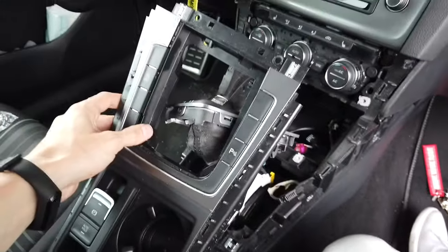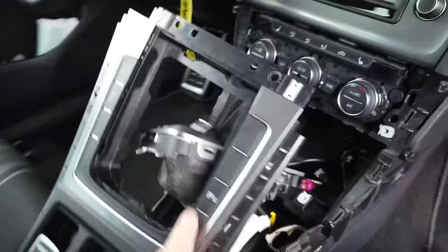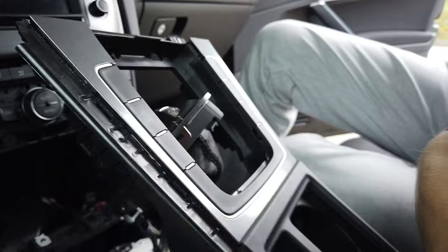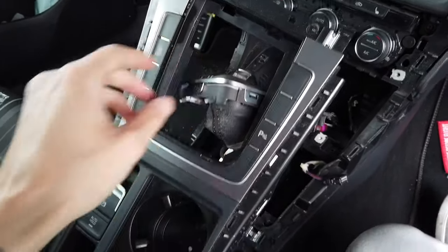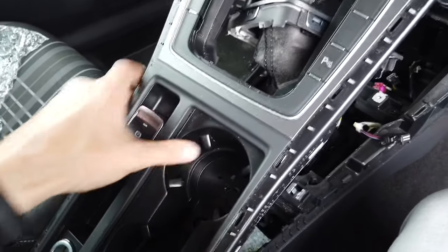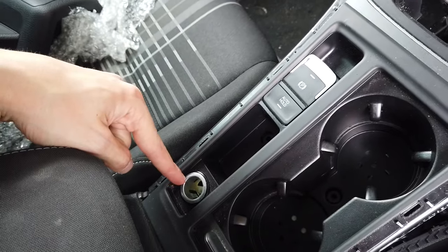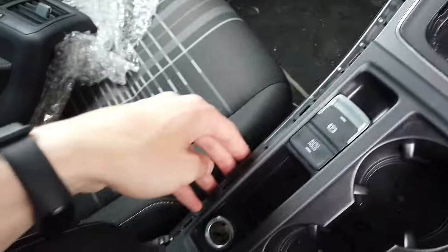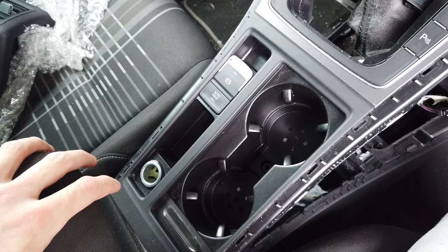I used a prying tool just to release it, then you can move it a little bit higher — but that's not all. You need to disconnect the wiring over here for the parking sensor, and the wiring over here for the start/stop button. Those two connectors are undone. I've guided the leather trim through the hole and right now only two things are still connected: the parking brake if you have the electronic one, and the 12 volt lighter. Once I undo those two connectors I'll be able to remove this completely and work on the wiring.